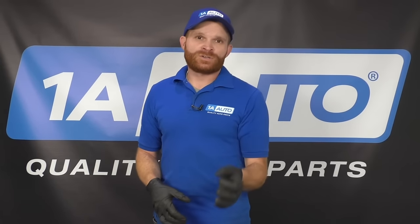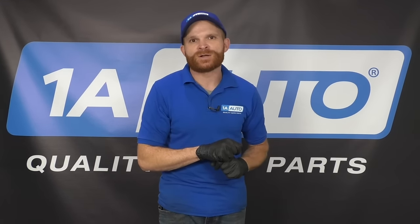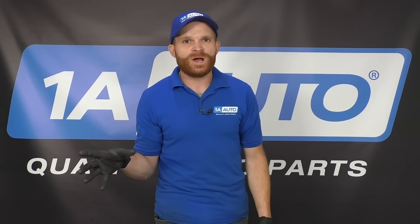Friends, we tried to make you a nice educational video about brake pulsations. We want to make sure that you understand it might not necessarily only be your brake rotor that's an issue - you have to pay attention to your whole braking system and make a determination on what needs to be fixed. If you have to replace your rotors for any reason, you need to replace those pads no matter what, and vice versa. Nobody should be replacing just the pads without the rotors or just the rotors without the pads. Obviously if you have a caliper issue, that's going to need to be addressed as well.